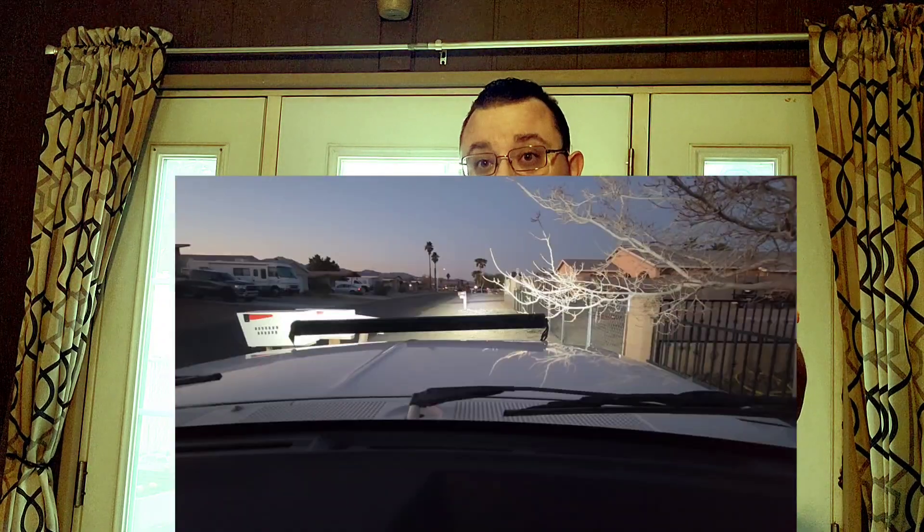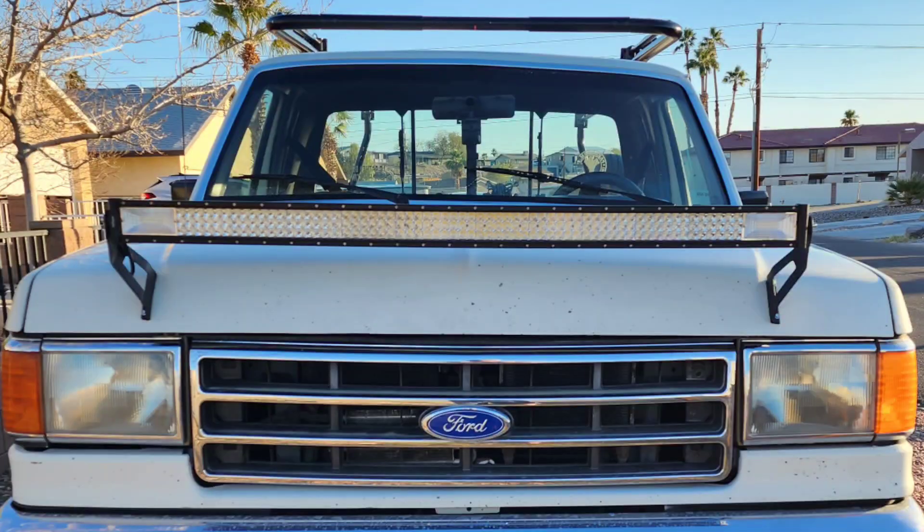For the front truck light around the hood, that was a little more involved because I had to mount the light brackets, drill a hole through the hood, and run the wires into the hood. Because of the way the hood is built, you have that X-frame inside where it's hollow, with hollow side rails — I ran the wires through the side rails.